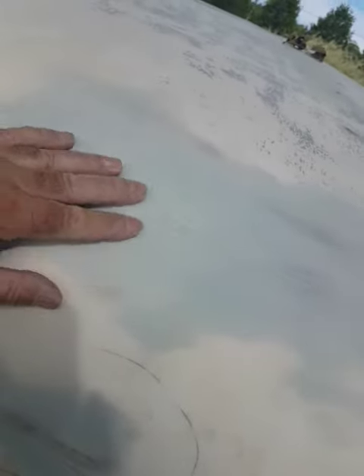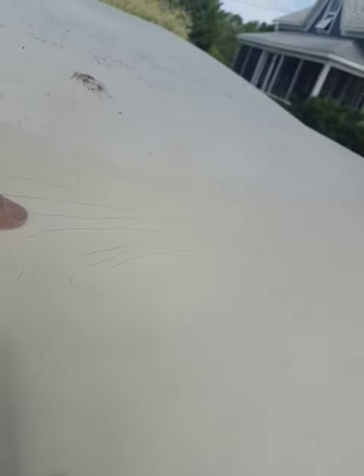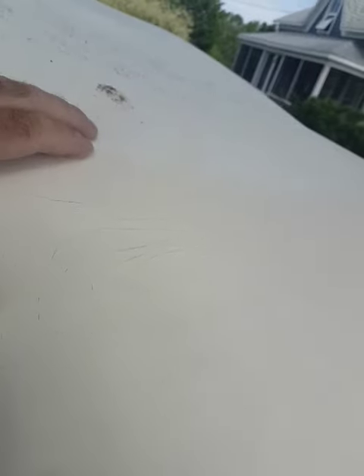Back here I'm just going to do a test. These here are spider cracks that have been kitty haired and then bondoed. And here are spider cracks that I'm leaving to see how the epoxy primer fixes them. They're high enough I won't see them if they don't work.